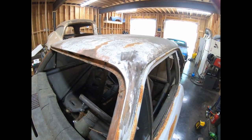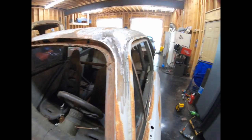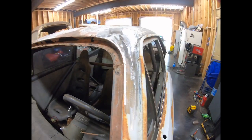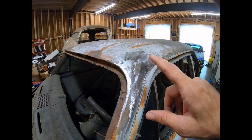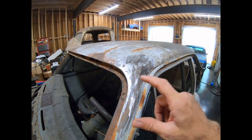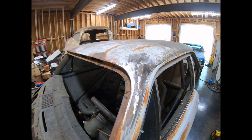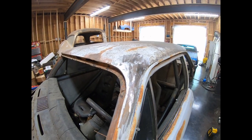We're going to hit this with a torch. Now, you got an old car like this that's been sitting outside, there's going to be leaves everywhere. I had a couple of fires taking that quarter panel off where I used a plasma cutter. Anyway, we're going to hit this with a torch. We're going to keep the flame away from it because it does not take much heat to melt lead. We're going to get that run down and hopefully not on me, and let's get to it.